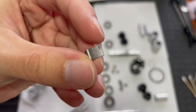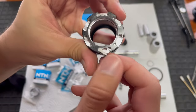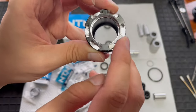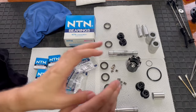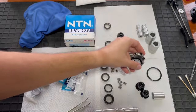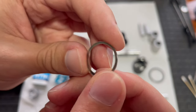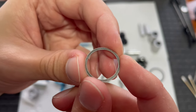The pawls are wearing slightly lopsidedly on one edge, probably because there's a tiny bit of movement where the pawl sits in the hub body - it wobbles slightly up and down, so it's not engaging completely flat with the teeth on the inside of the hub. Not a major problem. One concern is this spacer ring - the small washer that sits behind the hub body between the hub body and the 6903 bearing. It's showing a lot of wear for such a thin piece of metal despite having plenty of grease applied.